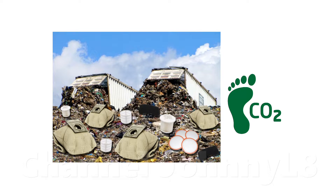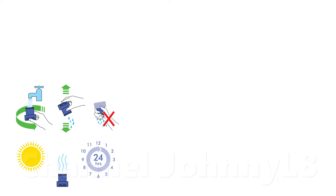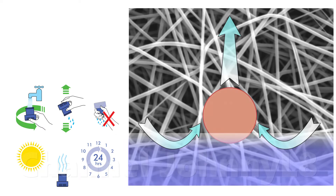Incidentally, poorer manufacturers of vacuum cleaners expect the user to throw away clogged filters and buy new ones, which is expensive, wasteful, and harmful to the environment. Manufacturers recommend rinsing filters with water for two main reasons. Firstly, water is a much denser, heavier fluid than air, and does a much better job at dislodging far more of the trapped particles and microscopic scales. It can also help chemically unstick any that are bonded to the fibres.